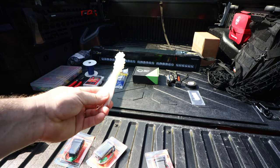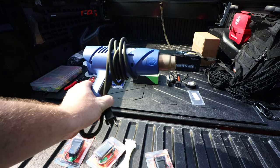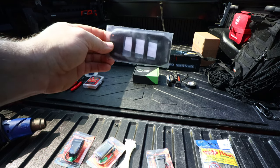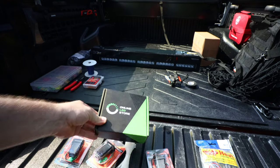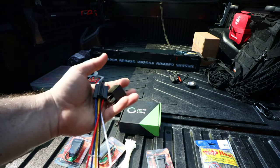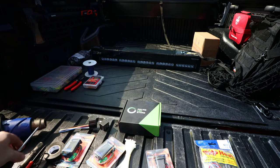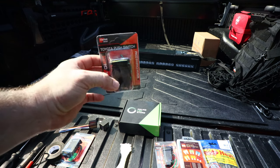In addition to the switches I also have a set of zip ties to help keep the wiring nice and neat. I have a heat gun to shrink the heat shrink tube, and here's the heat shrink tube I'll be using. Here's the switch panel that works with these OEM style switches — we'll need to remove a trim piece off the dash and install this panel to add the switches. Here are relays rated for 30 or 40 amps depending on how you wire the relay circuit, available in a pack of six or ten. I also have electrical tape, a pocket screwdriver, a flashlight for seeing under the dash, and a Phillips screwdriver.